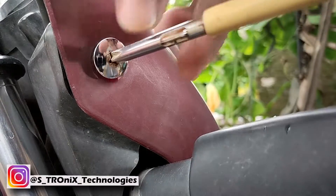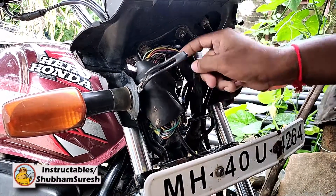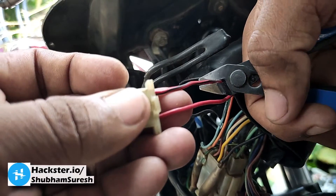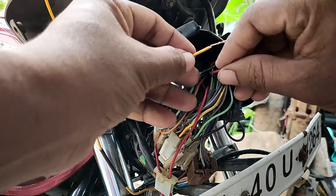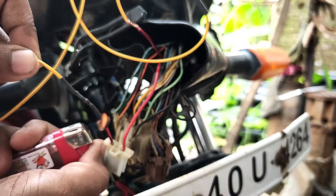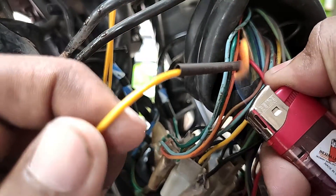Now let's go outside and connect it with the bike. I am testing this circuit with my Honda CD Deluxe. Unscrewing two screws with a screwdriver and a third with a spanner, I open the headlight cover. You can see lots of wires here, but don't worry — you just need to find the two-wire harness coming out from the bottom of the ignition key. I remove it and cut one wire, remove insulation on both ends, connect them with the yellow wires from the modified key unit, and secure the joint with heat-shrink tube. I connect the key unit in series with the ignition lock switch.